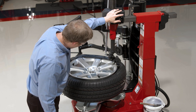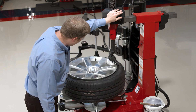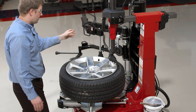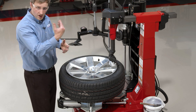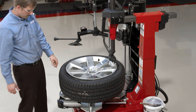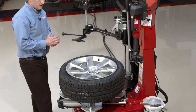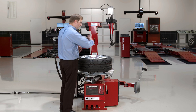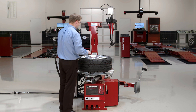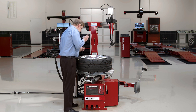Go ahead and start to rotate around and just sort of watch everything. Once I know that tire is mounted up — it gets to about the nine o'clock position — I can go ahead and pull my tool hook all the way up and pull my bead press out. Just a neat trick you can use, using the hook itself as a press device essentially to help maintain that over-under condition and help push the tire under the drop center. And I can go ahead and inflate this tire normally — always make sure that anything over 40 PSI you're inflating in a safety cage.